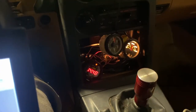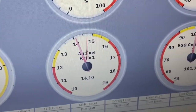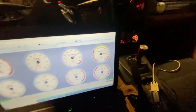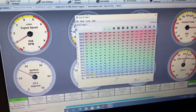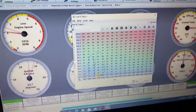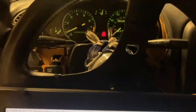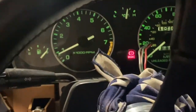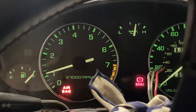If you're going to be data logging using your wideband and the Megasquirt, make sure they match. These are very close — good enough for me — but I've seen them have huge offsets before, so don't let that trick you. I've got my idle and a little bit of off-idle, part-throttle dialed in, and mainly got the idle control set up exactly how I want. You'll see how this thing returns to idle — drops right back down like stock, doesn't overshoot, doesn't undershoot.